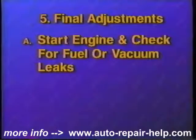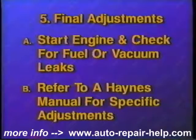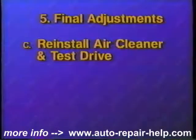Step 5, final adjustment procedures. Start the engine and check for fuel or vacuum leaks. Refer to a Haynes manual for the specific adjustment procedures involved on your particular vehicle. Reinstall the air cleaner with a new air filter and test drive the vehicle for proper operation.